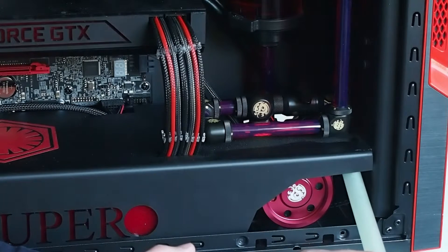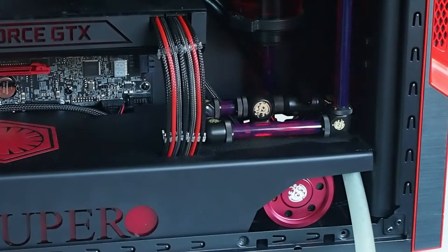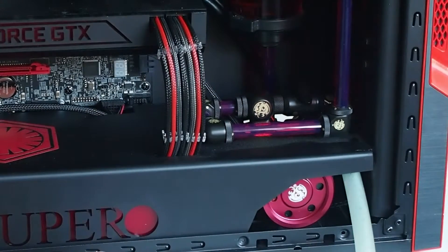It fills itself with air and it might take a little while. To make it a bit easier you can tilt the system a bit so the water will flow in that direction and the top radiator will empty completely. The loop doesn't need to be bone dry — just as long as most of it is out, there should be no problem, because the tap is basically the lowest part of the loop anyway.